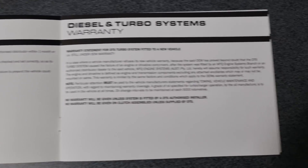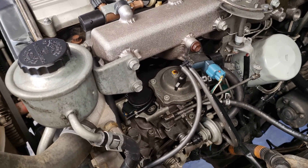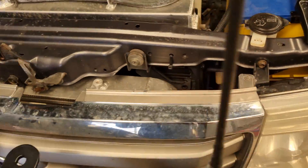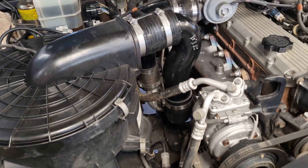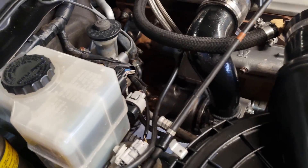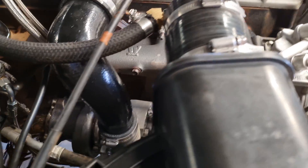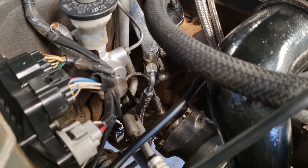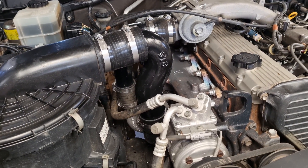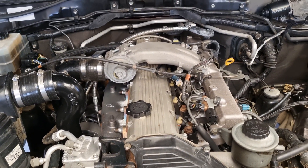Here's a shot of the DTS warranty. There you have it. Next video we'll modify the altitude compensator to behave like a boost compensator, and rear dyno. Also fabricate some cooler piping for the front mount, might also install a catch can and adjust the baffles below the cam cover. I recommend installing one of your coolant T-pieces below your exhaust manifold just after the thermostat — it'll aid in reducing clutter and give you more room near the pyro. This DTS kit's a good quality kit and really easy to install — will take you one day if you stab the sump, or one and a half days if you remove the sump like I did. Hope you like this vid, stay safe and wind the boost up.